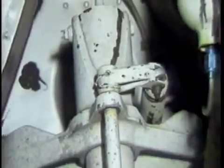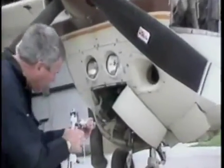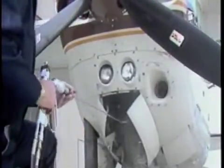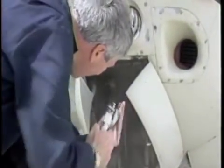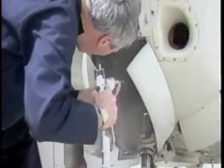Let's now go to the nose gear and wheel well. The process is simplified by using a wand and letting the spray do the work. The amount of material used will vary depending on the condition of the aircraft. Older planes would require more Corrosion X and additional attention to detail. In order to determine proper coverage, visually inspect the treated surfaces for a wet, shiny appearance.